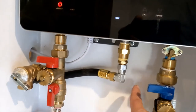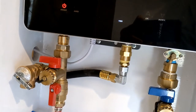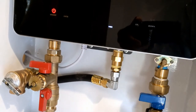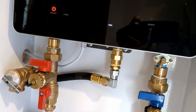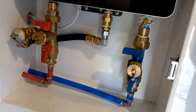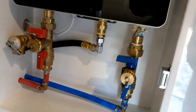This water heater is propane, so we've got endless hot water and we don't have to worry about running the van if we've been parked for a week. There are some valves here you could use to drain this if you wanted to leave it cold. Though if I was going to freeze this system, I'd probably end up blowing the whole system with an air compressor to make sure it's all cleared out.